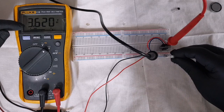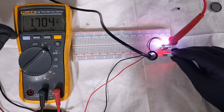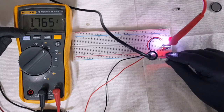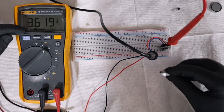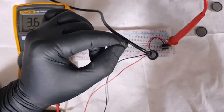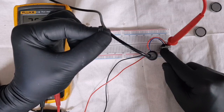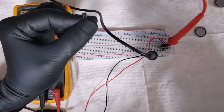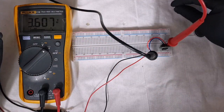I'm going to present the magnet — north side or either way — to this hall effect sensor and we're going to see if the light turns on or not. We present it here, we notice no light, but as we present the other side, we notice as we get close to it the light turns on and it turns off. The voltage goes down to about 1.764 volts when it activates. So we know that the hall effect sensor that was part of this packaging is damaged and faulty. I'm going to replace it out with this one and reassemble it to determine if our fault is erased and we can get this ES2 Segway electric scooter back operational.